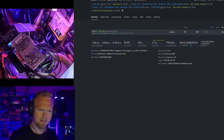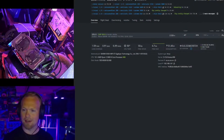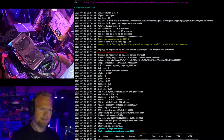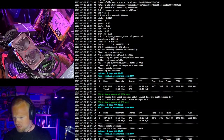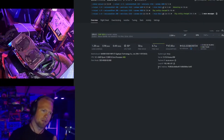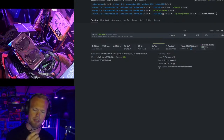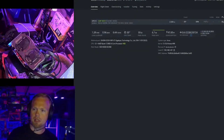We're seeing between 42 and 60 watts — not sure what to believe. 58 is actually a little higher than I'm seeing here for the most part. It didn't lock, that would do it. We're at 2.528 at 52 watts. Before I was getting 2.67 kilohash at 48 watts, now we're getting 2.58 at 49. It's worse, but not a ton worse. For the record, this is the CMP 30HX — it's the closest to profitable thing you can currently run. If you're on 12 cent power with this card and decent overclocks like this, you would actually be able to mine and sell for a profit. Dynex is unfortunately your white knight.